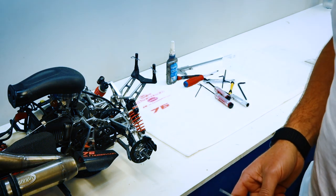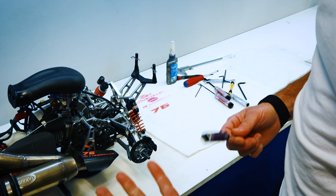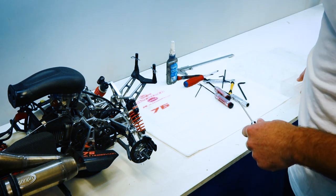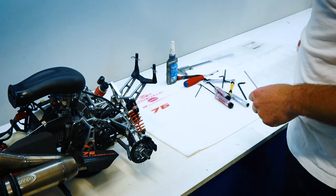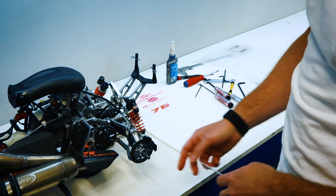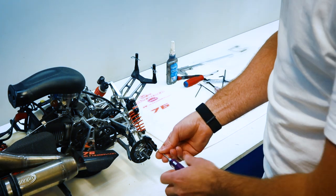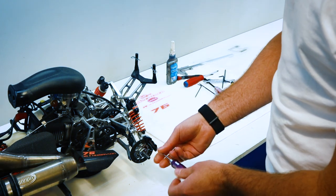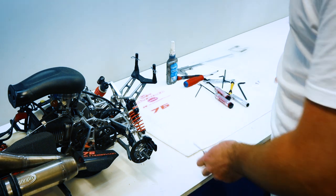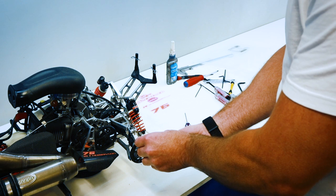Something I do when I'm pulling apart the brakes or some other parts in the car is use a plastic tray and put the parts in the tray so I don't get them mixed up. It's pretty important with the brakes to keep the pads as a matched set, as well as the disc if you can. So these trays come in handy.